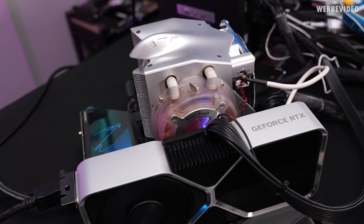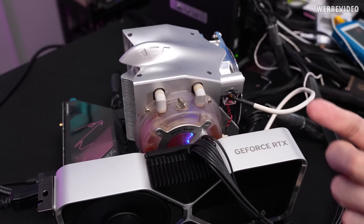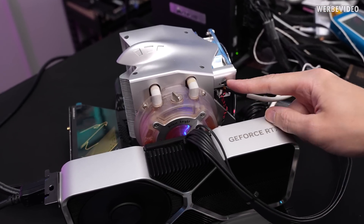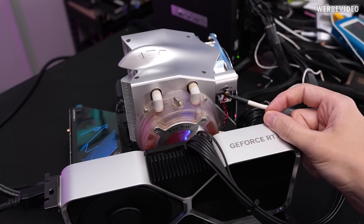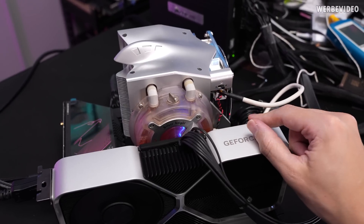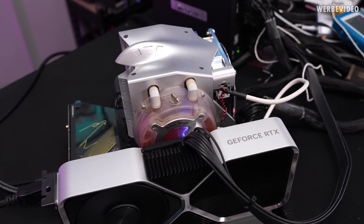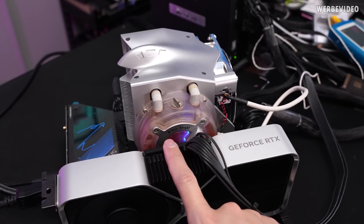After one hour of usage, the water level is a little bit lower, so some air went out of the system. At least I couldn't spot any leaks, which is good. I also want to point out that I was testing on low fan speed, because on high it's quite annoying — though high speed is actually closer to the AMD boxed fan noise level. Maybe one or two degrees of headroom on high speed, but definitely not worth it. The water noise and pump noise on low is already quite insane.